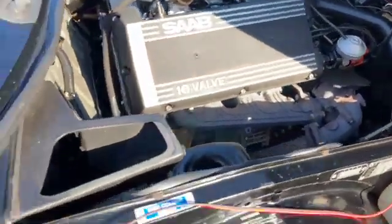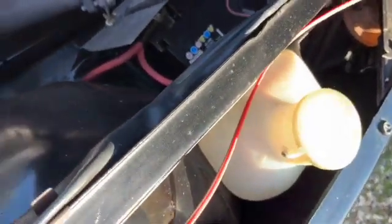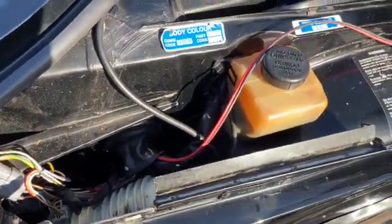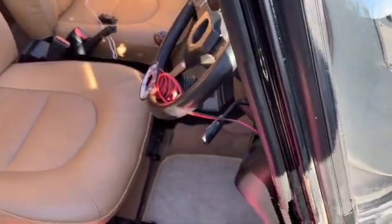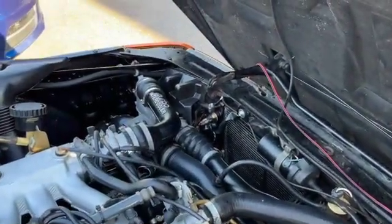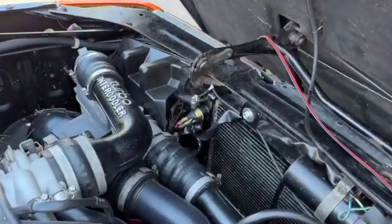Now I will insulate the wire properly — at the moment it just has its natural casing, but I'll put some additional casing on it and try to run it into the trunking that's already there. Basically the system should now be in place; the wire is in place. All I'll have to do is attach a couple of connectors to the end to put it onto the back of the switch, and take a spur off over there. So that's where I am — next I'm going to go over there and put the ends on.